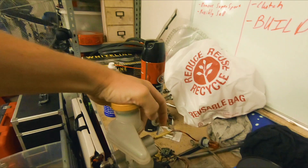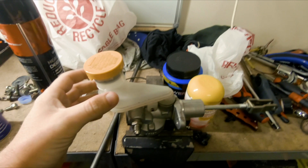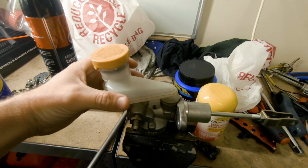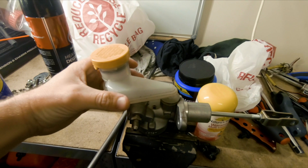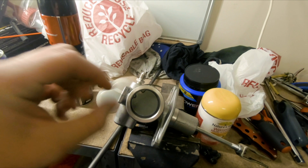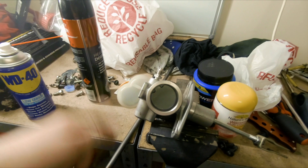There will always be a little bit of clutch fluid left in the unit. Remember: clutch and brake fluid is not good for your paint, so clean up anywhere you see it, use one rag for clutch and brake fluid and throw it away after. The problem is you can notice the fluid starts turning black inside there — that black gunk is causing the issue. Underneath there's a flat plate with a circlip holding it in. Remove the circlip, everything comes out — keep all the bits and remember the order. Once you get it all out, give it a good clean, put it back together with the circlip, reinstall it, fill it up with fluid, and you won't have that clutch issue again as long as you keep cycling the fluid.